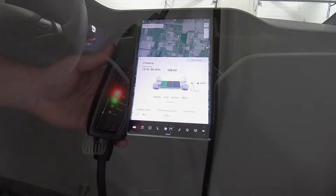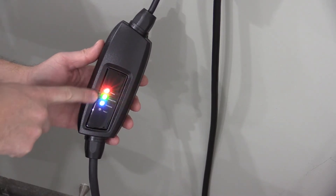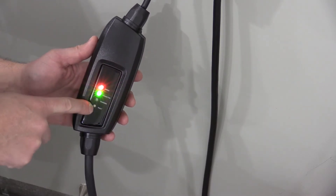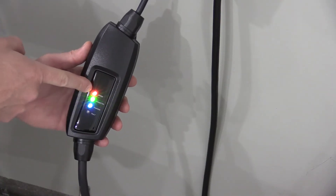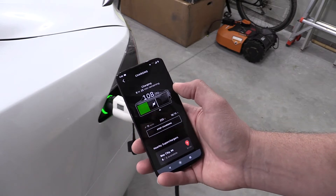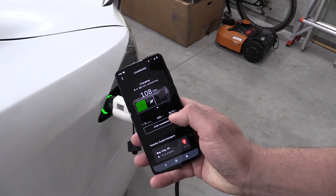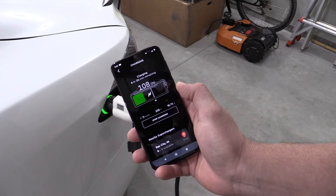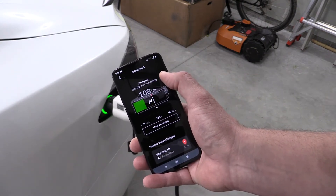While this charger is connected, it tells you what's happening, and if you had any faults or poor wiring it would be blinking in the fault box. Closing the doors and turning the heater off made a huge difference — you can see I'm now at 235 volts, 16 amps, Level 2, at 11 miles per hour, bouncing between 10 and 11.